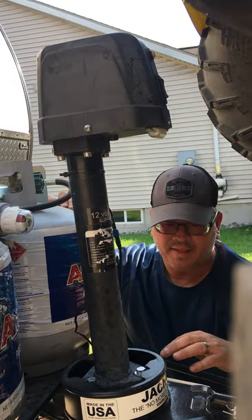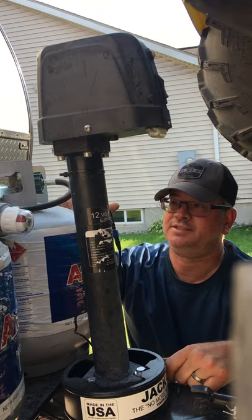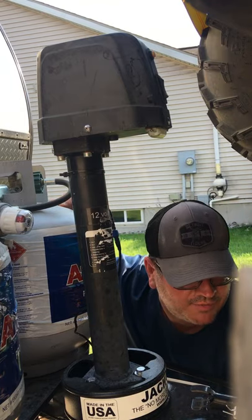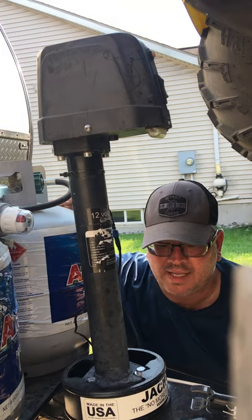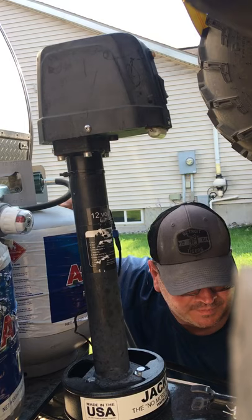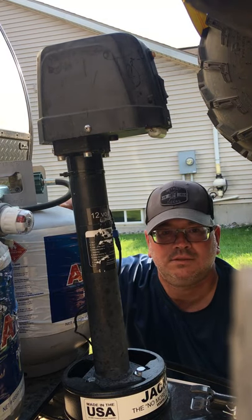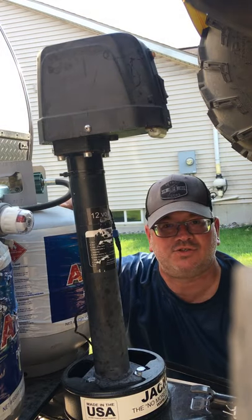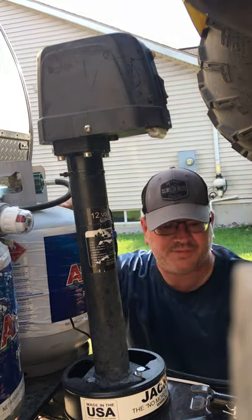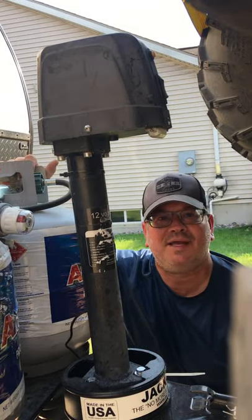She's locked in place. Next time I hitch it up, I remove this. Plenty of clearance — I've got six inches all the way around. This is a pretty affordable setup; I think this is like 50 bucks. My air shocks were about $280 and help with the leveling so the truck doesn't squat. These Dodges have coil suspension anyway, and it drives like a dream — about a thousand pounds below my payload.